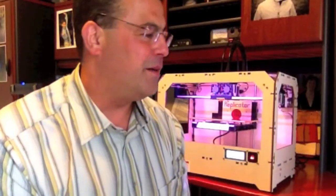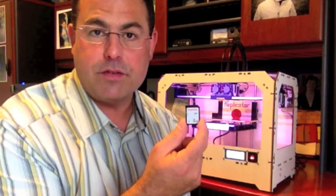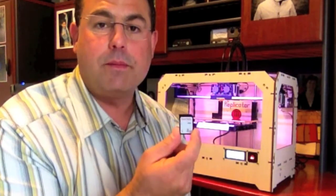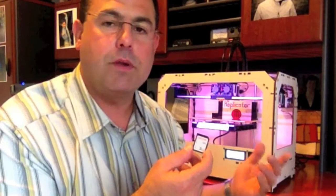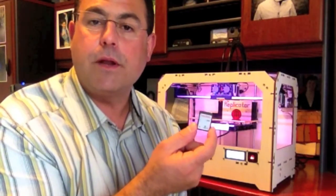I wanted to point out you can print to the MakerBot by two means: you can connect the USB cable and connect to it from your computer, or you can use an SD card. From what I understand, it's highly recommended that you use the SD card and not the USB cable. Evidently there are some problems with minor interruptions while printing through USB that can cause problems with the print. Later on I'll show you the software and how to get your file on the SD card properly.